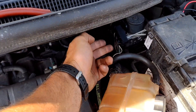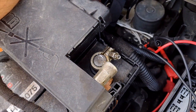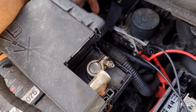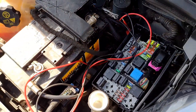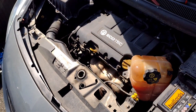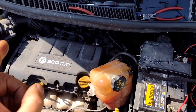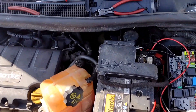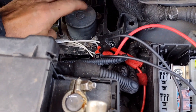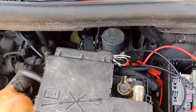What I've done here is jump — there's two sets of CAN wires, a blue and white wire: CAN high, CAN low. There's two pairs of those wires. So I've just jumped the blue to the blue and the white to the white. And when it's like that, everything on the car seems to work, including the power steering, except for the ABS, obviously, because it's not connected. So even though I'm here to look at the power steering, I found that jumping the ABS module out like this, the ABS isn't used, but I get the power steering to work.